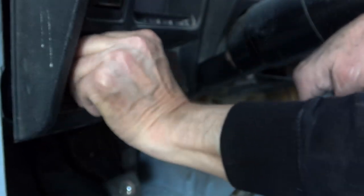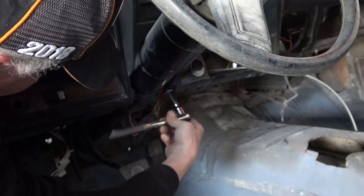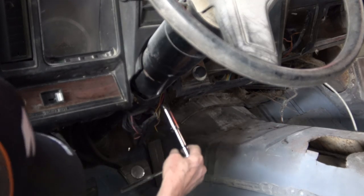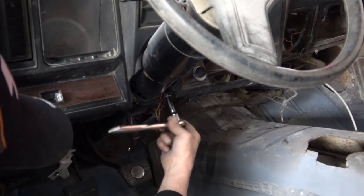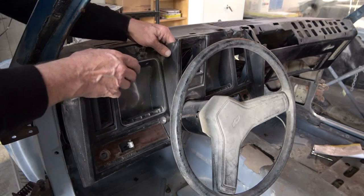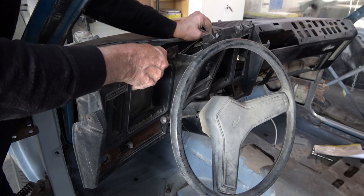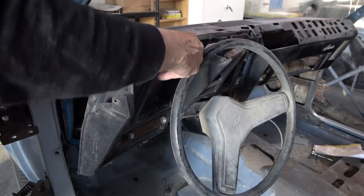All the bodywork is ready to go and it's ready to paint. As you can see, I'm removing all the screws and bolts around the instrument cluster. On these clusters you have to lower the steering column to give you room to wedge the cluster out of there. As you can see, I'm removing the steering column bolts from below. Some of the plugs behind are pretty tight, so I use needle nose pliers to unplug items that are difficult to get to.